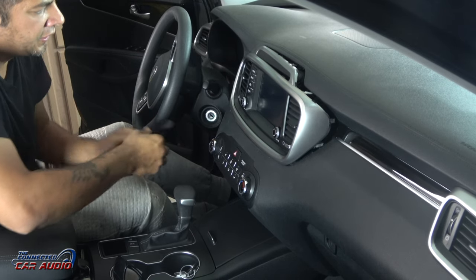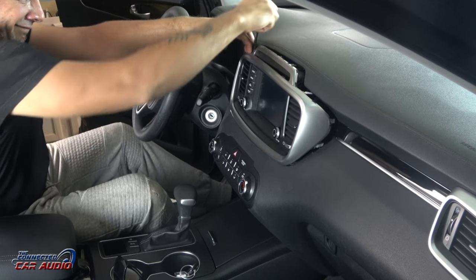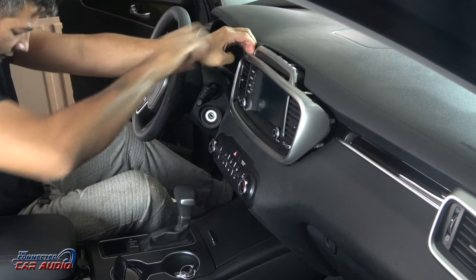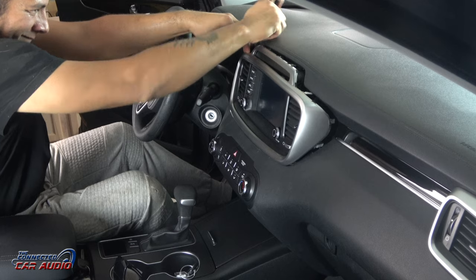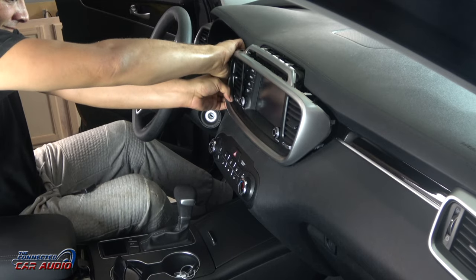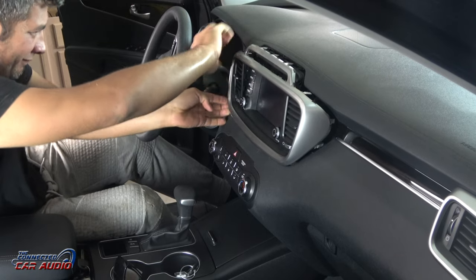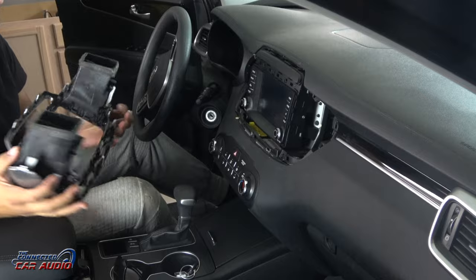It takes a little while — it took me about seven minutes of doing this to get it to release. And when I did pull it out, it almost flew out of my hands, as you'll see here. Definitely do not try this with a flat blade screwdriver. Make sure you have a non-marring tool and grab the meaty sides. I just want to show here in real time so you guys have an idea how difficult it was.